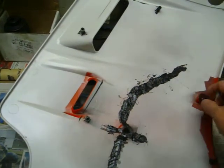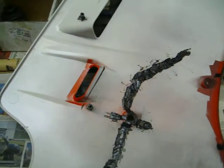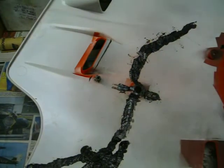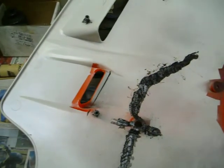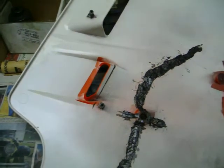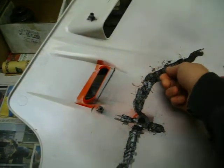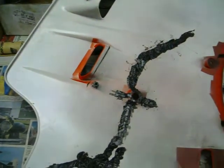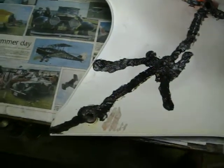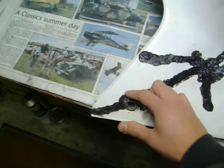And then I just went online and found out that this was made of ABS plastic, so, it's gonna sound funny, but I went down to Staples and I bought a clipboard that was made of ABS plastic, and I just cut strips out of it, and I heated it up and put it right in there. But I didn't weld it yet, and then once I had the material inside the valley, I went over it really slowly to heat both of them up together and put them together. So it was a little tedious, took a few hours, but I also put in a couple pieces that were chipped out of the one mount, just tacked them in and then welded them up after.